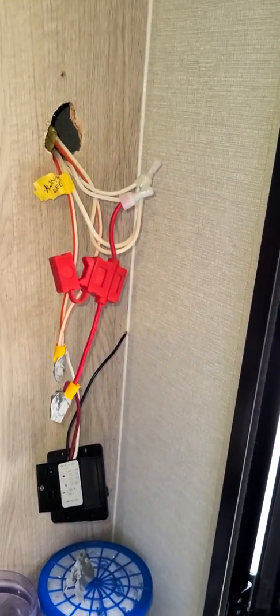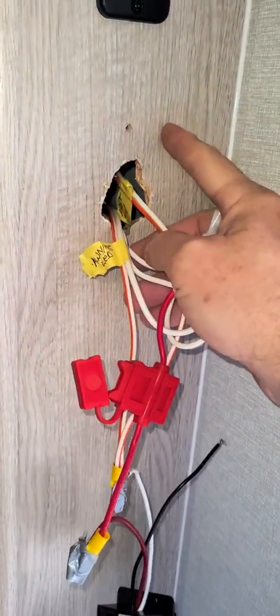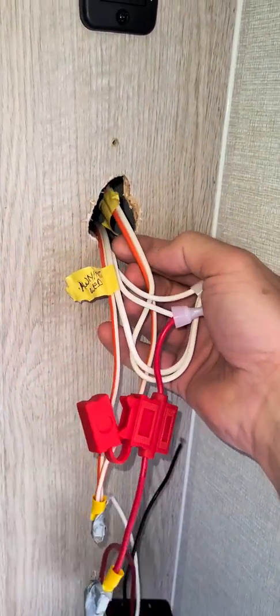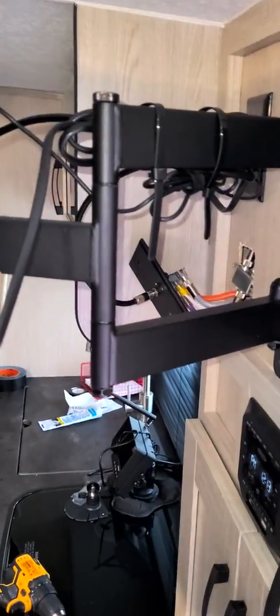So you had a specific question about the white bundle. Let me tell you what I've found. I have 3 pairs coming out of the original awning light switch. One is an orange-white striped mated with a solid white. I followed that back to the TV antenna booster, which is only about 2 feet away.